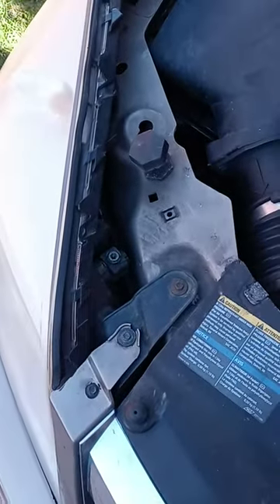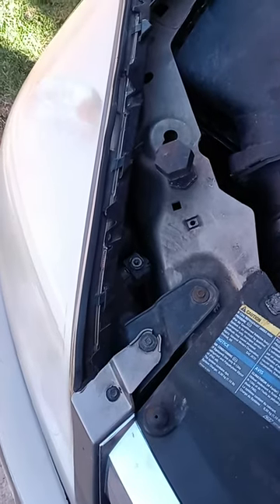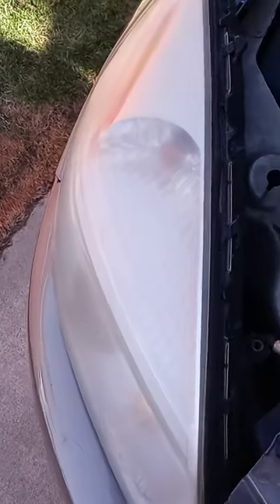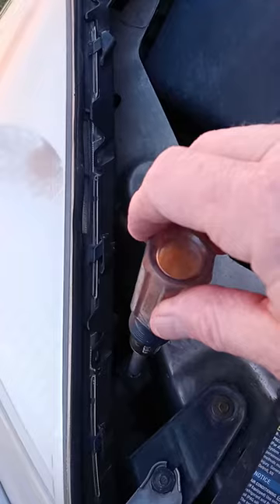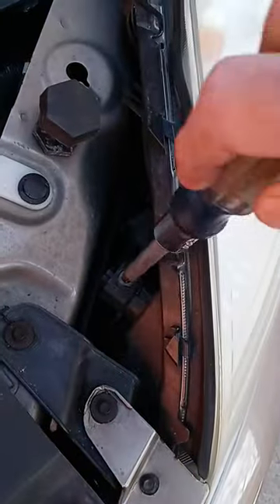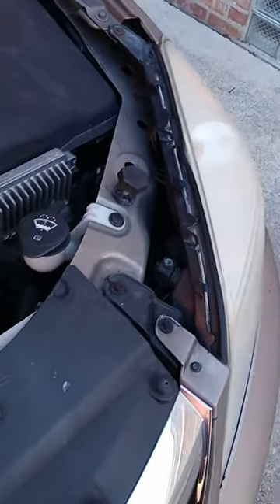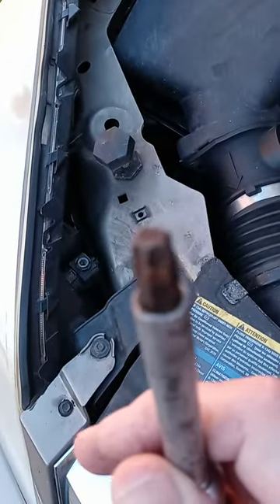So on this one, if you want to lower it you go clockwise, and if you want to raise it you go counterclockwise. I've been noticing when I drive that the headlights on this car are a little bit too high — kind of hitting the signs and stuff. So right here I've got it inserted and I'm going to go clockwise, just about a fifth of a turn on this one, and then the same thing — about a fifth of a turn on the other side. Then I'll drive it later tonight and see how it works. That's how it goes.